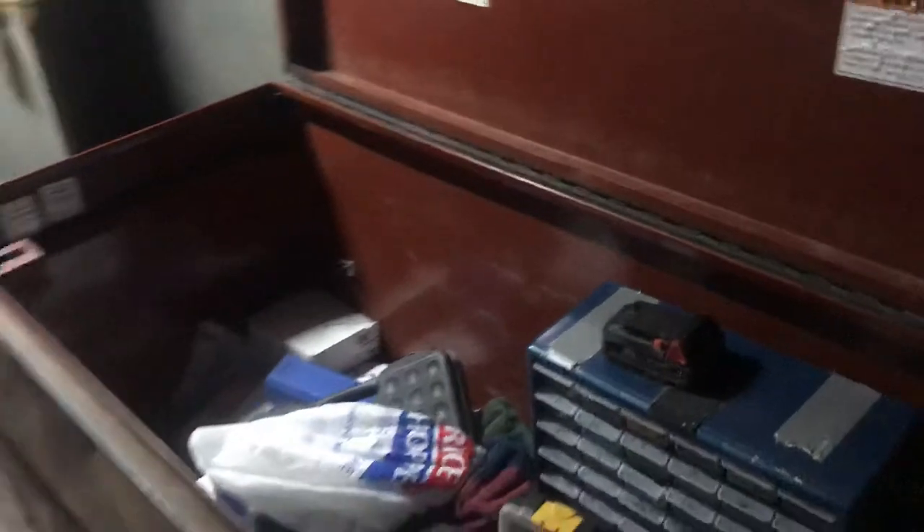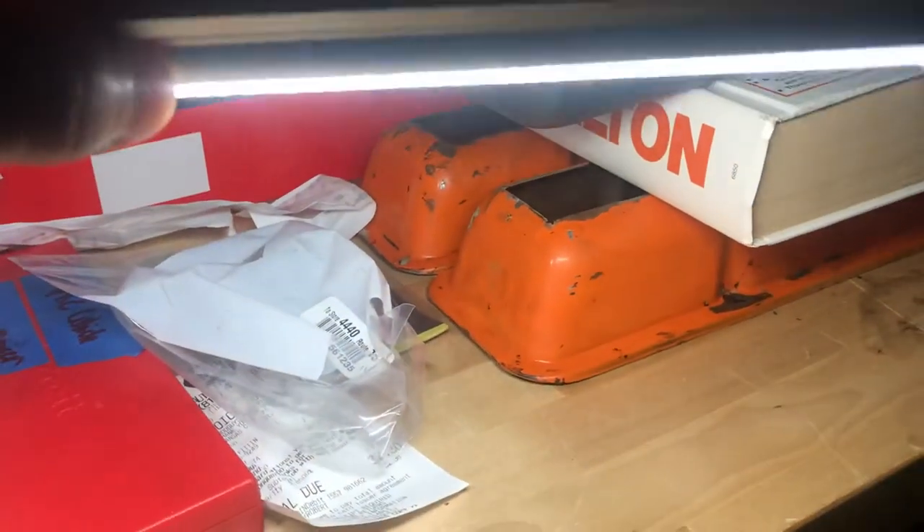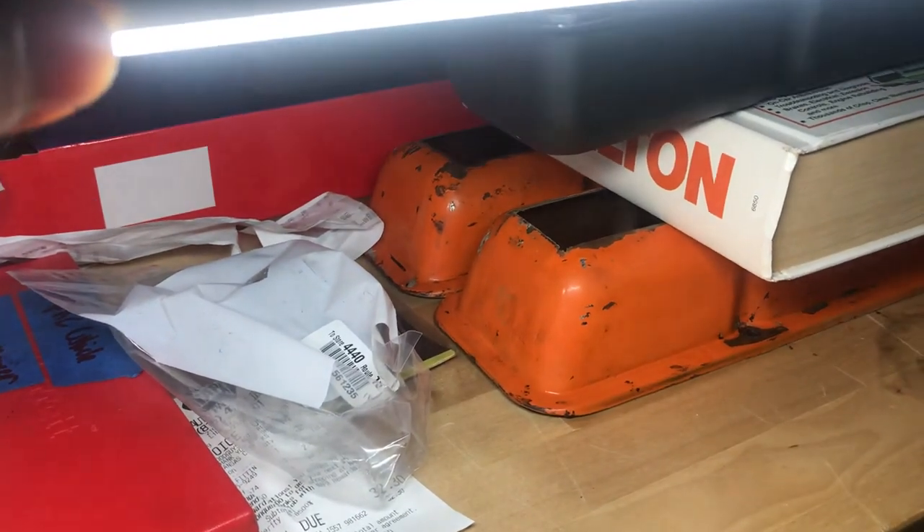I'm gonna go ahead and get off here. It's kind of a boring video, but I've seen some new subscribers join and I just want to give a heads up that I'm still trying to get this thing going. Hopefully by the end of the weekend I'll be back on the road. Here are the valve covers — I cut that slot in here and glued the gaskets onto this part of it so they'll stay on without me trying to line up holes. I just got a bunch of weights sitting on top.